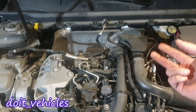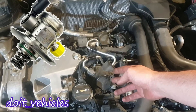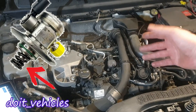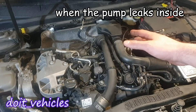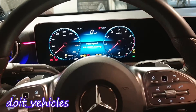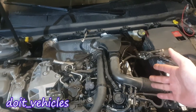Some of those gasoline vapors will go inside the cabin and you're going to smell gasoline. However, you might think the pump is leaking externally, when in reality most of the time it's going to leak internally through the piston which is activated by the camshaft. Check the live data with the fuel trims and check the oil level, because most of the time you'll find the oil level over the limit. On this car it's measured electronically, so you'll probably get a message on the dashboard.